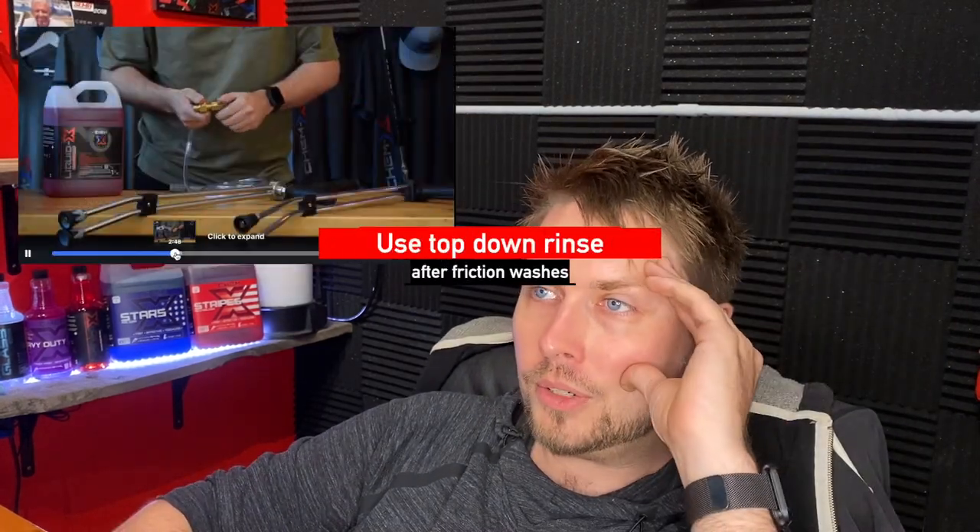This is what happens when you don't rinse close enough, or don't have high enough PSI, or the soap isn't coming out as strong as you think — whether from a foam cannon or a power washer soap injector. It just means you either need to put more soap in or rinse a little closer. You don't want to be able to write messages to people in the vehicle after you've finished washing. If that happens, the soap was either way too weak or the rinse needs to be closer.